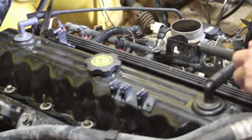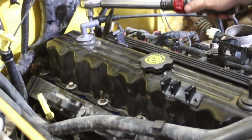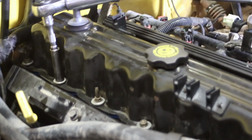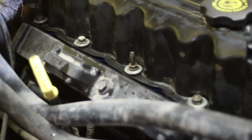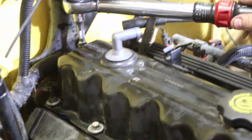As you do this over and over again, you'll get it by feel. You'll know where you need to be. But go ahead and stick the bolts in, get them all hand tightened. That part doesn't matter, but get all the bolts in, get them hand tightened, somewhat a little tighter, and then you can get them torqued down.